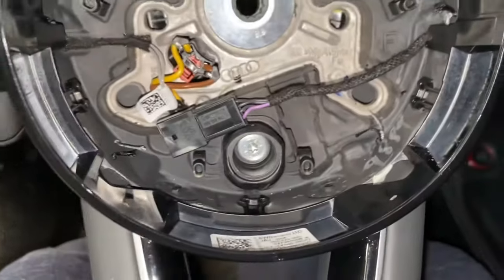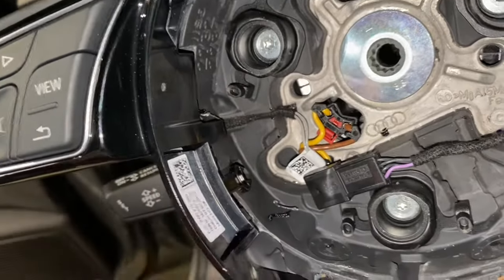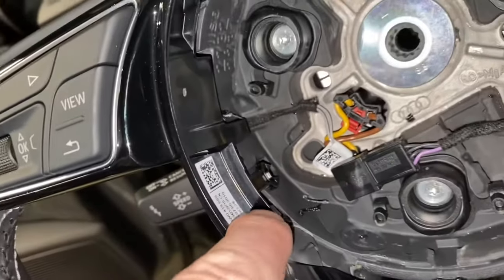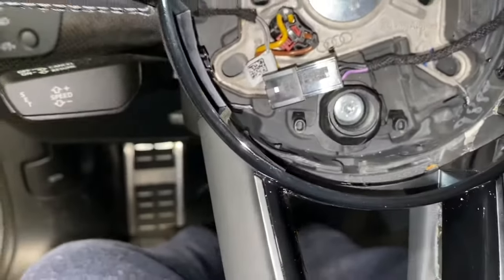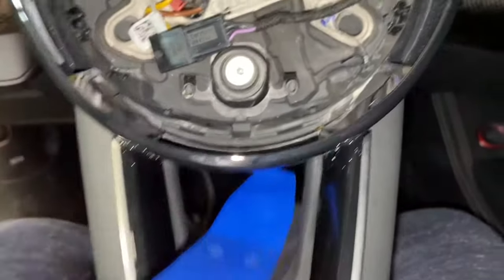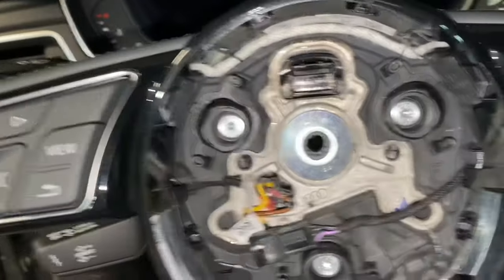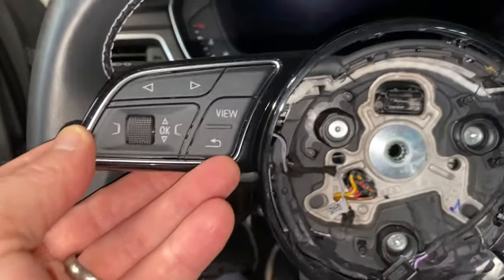After pulling really gently and getting this tool kind of in, I was able to get it to start pulling loose. I did that on both this clip and this clip, then moved to the bottom — using this end to very gently pry the bezel up here helped me get the middle one out. Now everything seems loose and I've just got the two ball-joint style clips underneath each one of the control panels to very gently move up.